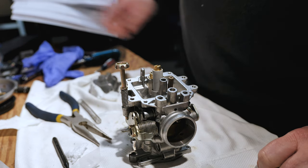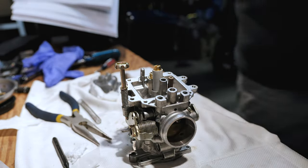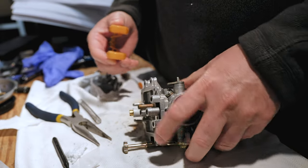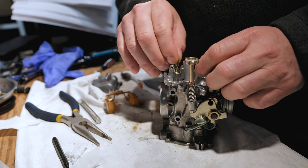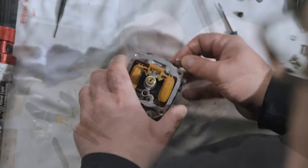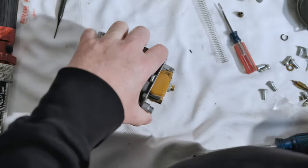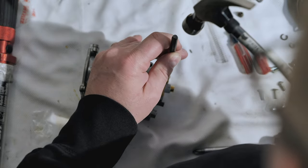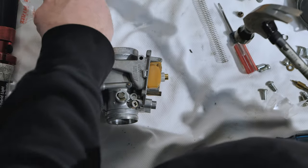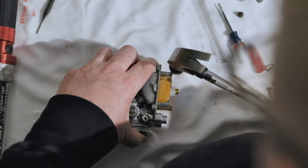The floats are over here. I was lucky with these carburetors, mostly because the bike does not have very many kilometers on it. The floats don't leak — they're all in good shape. The floats go in here and we use the pin to drive them home. Place the floats in position as shown and insert the pin. The pin will need to be driven into place using a small punch and a hammer — the punch should have a flat end. Lightly tap it into place, not hard. You don't want to damage the carburetors. Check it frequently to make sure you're not overdoing it.